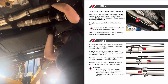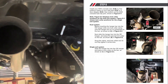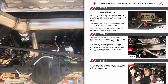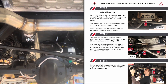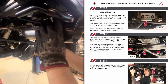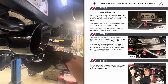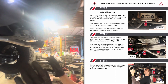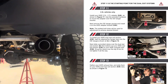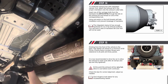In step six, we're installing the over-axle tube. Once that's done, you can decide if you want to add the bash guard or dual exhaust. Step seven is very important — if you have the single exit system, skip to step 11; if you're doing the dual exit with a 2.7 like me, skip to step 12. If you have the 2.3, you'll need the additional hanger that's included. Once your tips are in a location you like aesthetically, move on to the final step: fully tighten all the clamps starting at the front and moving back.